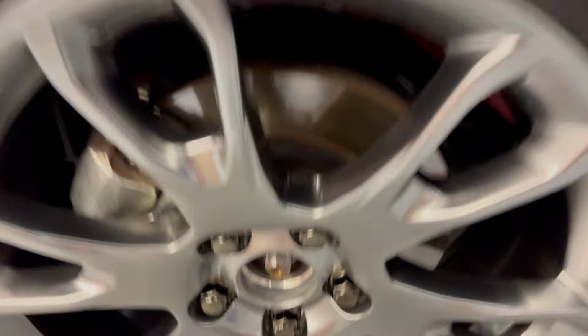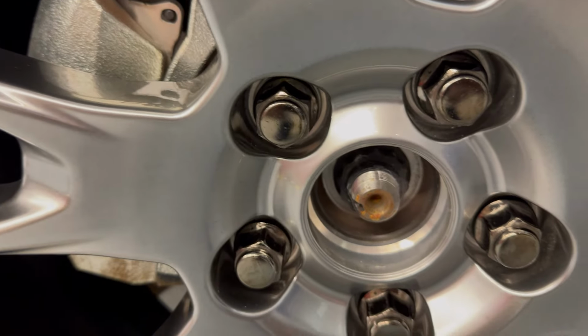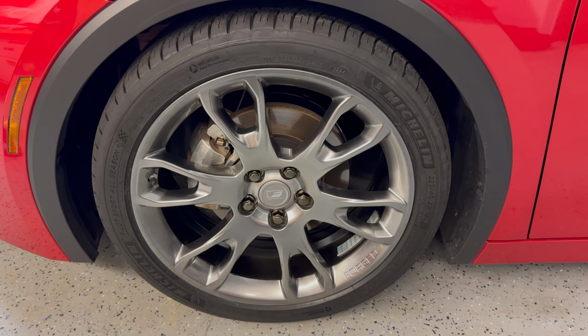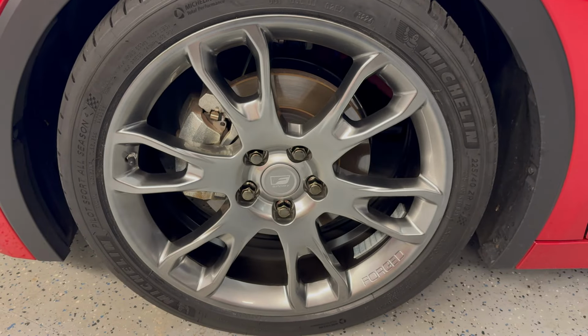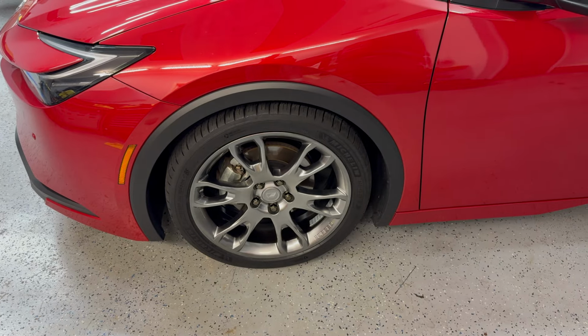One of the other nice things about using an OEM wheel from a Lexus is that the hub is a match. So they're both a 62 millimeter hub, so no hub centering ring is required to install these wheels. As these were an optional Lexus wheel, they obviously have F-Sport badging. I'll see if I can find some matching Toyota ones, but for now, this should do just fine.